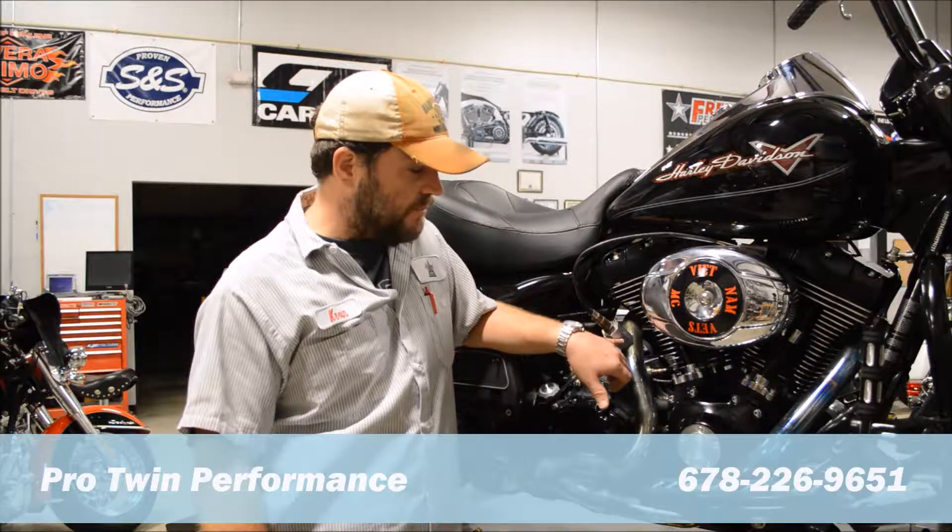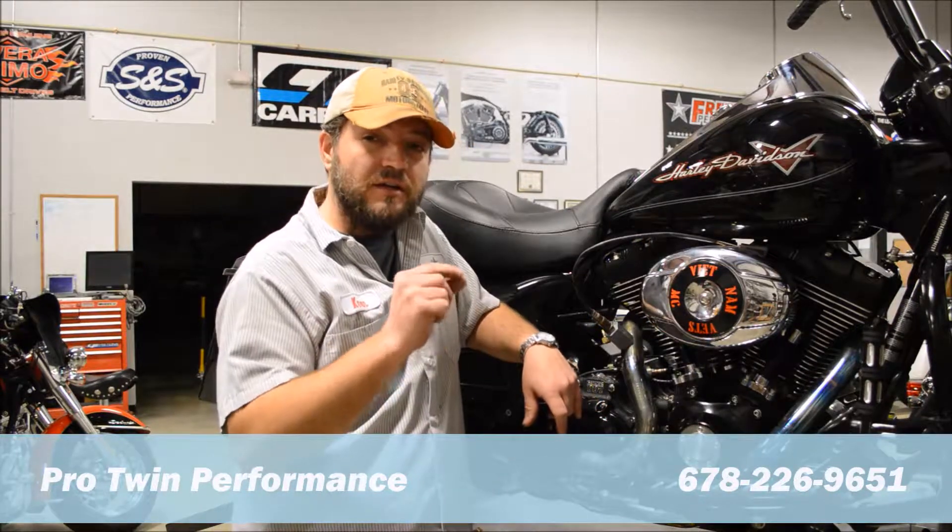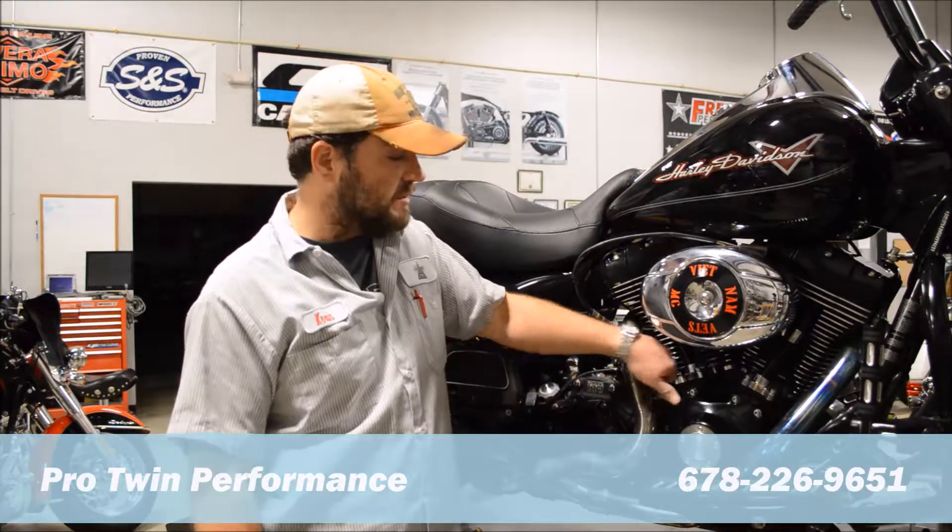Of course, you would repeat the process for the front cylinder. The whole deal takes five to ten minutes. When you're done with your testing, you would remove the O2 sensor, the adapter, and the kit comes with plugs and copper washers that you install onto the rivet — it seals up perfectly fine. I've spent hours on a dyno using sniffers and also using existing O2 sensor bungs already in the pipe and compared the air-fuel ratios to using this method, and it is absolutely 100% accurate. I put a lot of confidence in it. This is a great, easy, simple way to tune without sniffers and without a dyno.